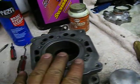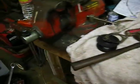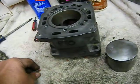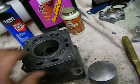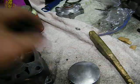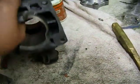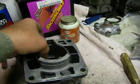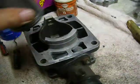And then I'm going to wrap these up in some paper towel because they're clean, and I'm going to set them in that box, and I'm going to cover the box. That way when I go to set this thing together, the parts will be clean and in order. I'm going to assemble my cylinder upside down like this. And remember, our arrow goes this way. So if we pull the engine upside down like this, we'd also turn the piston upside down as long as the arrow is going in the right way.